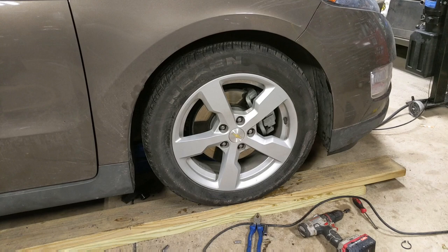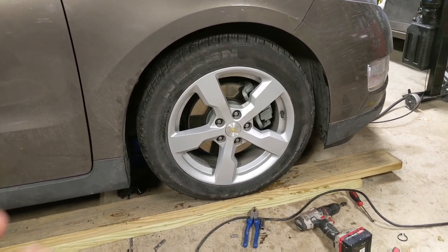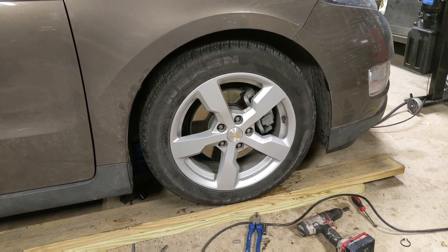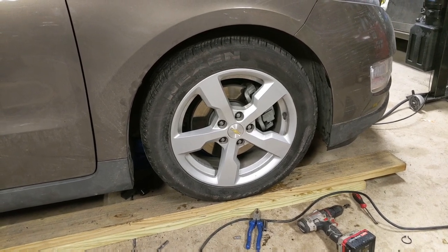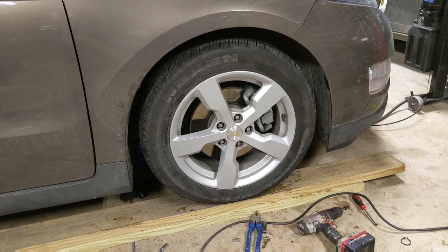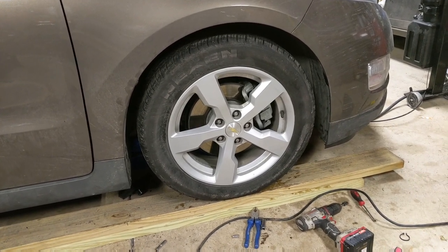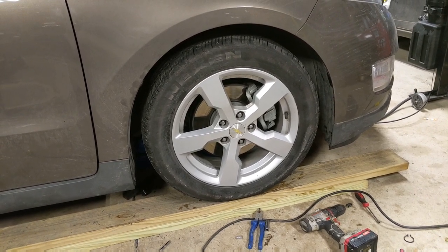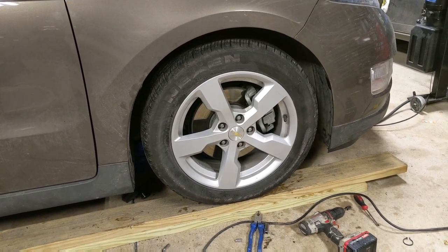With a little video editing magic, we're all back together. Basically just put the pump back on the same way you took it off. It's really not difficult to change this pump. If you're an experienced mechanic, half an hour to 45 minutes. If you're a backyard do-it-yourself type, maybe an hour to two — but no more than that. It's an extremely easy pump to change. The only problem is they run about $180 at the time of this video, but it's a lot cheaper than taking it to the dealership, which I think wants to charge about $700 to do this job.